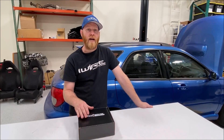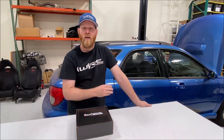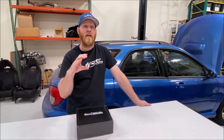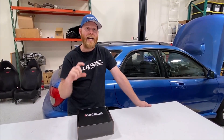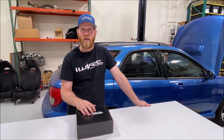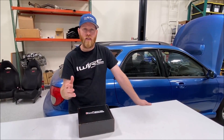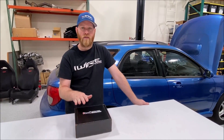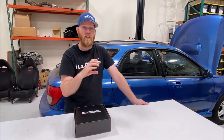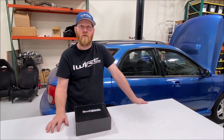The Cobb access port for the 16-bit ECU — these are cars attached to two-liter engines — doesn't have the capability to make the digital display on the access port read as a gauge. It's just the raw number. So it's great for data logging, which is why we're going to hook it up to the ECU, but you'll probably want an actual gauge so you can see what it's doing live. In this case we want both: the physical gauge while driving, and data logging to the ECU so our tuner knows what's going on.